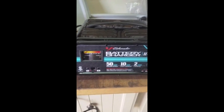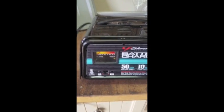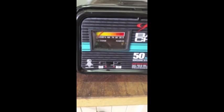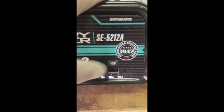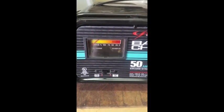Here we've got a basic battery charger from AutoZone. They've got fancy ones that do automatic stuff, but you don't want that kind. You want the kind that just charges and shows you the amps. We're going to do this on 10 amps for 15 minutes.